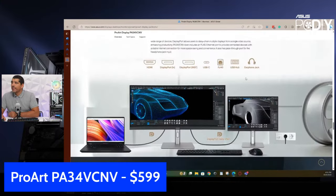So you can see right here, HDMI, DisplayPort. Now this DisplayPort MST, this is actually important to understand. Very few monitors have DisplayPort MST. MST essentially means that you have daisy chaining support. So instead of having to go back and connect that to your graphics card or another display out on the device, you can daisy chain from that primary display.